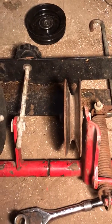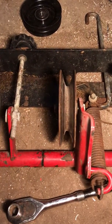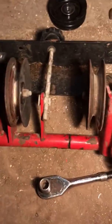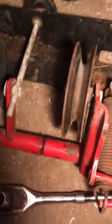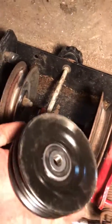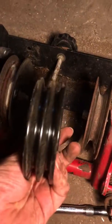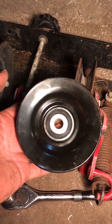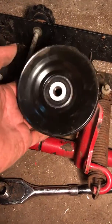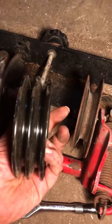Low power mode warning just popped up — I think I've got enough juice to record for another five minutes or so. Anyway, I was thinking of using this pulley. It's originally for some old Dodge application. A company still makes these pulleys — it's a double idler pulley, about 4 inches wide. The part number is 89056; you can find it on Google or eBay.